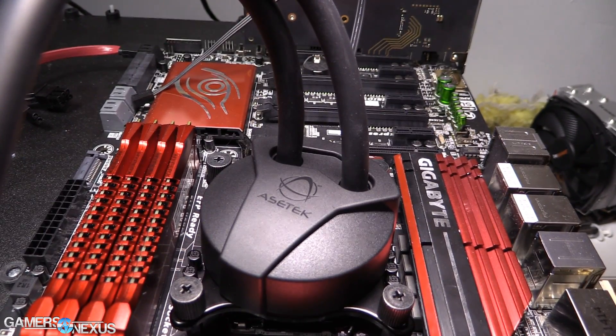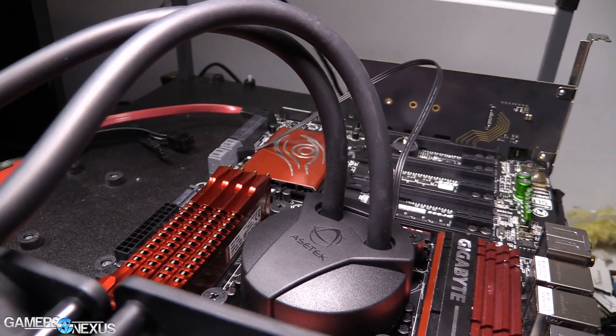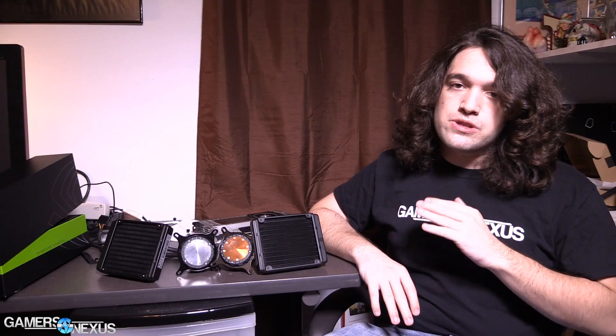The reason for this is possibly and likely because the efficiency of the pump is so great that the aluminum and the copper — even with a 2x difference in thermal conductivity — just doesn't matter as much. The way these radiators work is fairly simple: the pump sits on top of the CPU, and inside the enclosure there's basically a small propeller that spins and pushes liquid down into a channel below. When the liquid goes into that channel, it flows through what are called micro-fins in the cold plate surface.